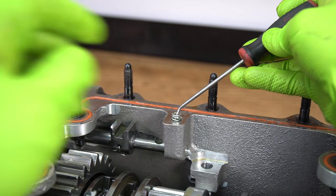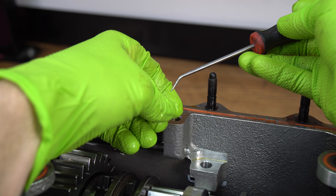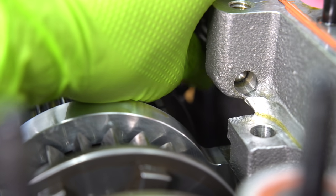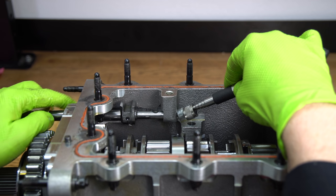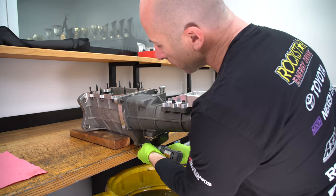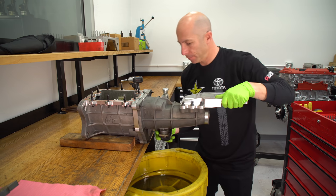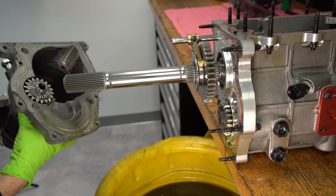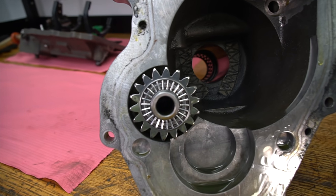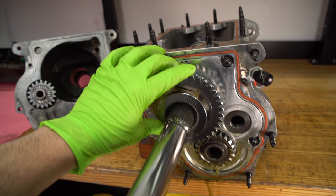This is the reverse detent spring and ball. Next we've got the detent ball — what this does is when you go into reverse, it goes into this little notch and gives you that feeling when you shift into a gear and it notches in. That's what the detent does. With that whole reverse mechanism apart, we'll pull the tail shaft off. The tail shaft removal exposes the reverse gears. When reverse is activated, it basically engages these extra gears on the backside — it engages one extra gear so it turns in reverse.